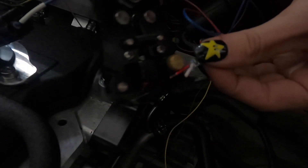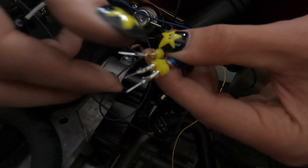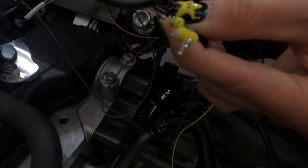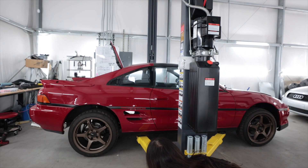This is kind of tricky — not a lot of room to work down inside here. I just added this red wire here with the white stripe. This one is an 8 volt source coming from the ECU — it's a regulated 8 volt source. I look like a Sasquatch in the wide angle. That's crazy. I'm so tall. I hate doing this.